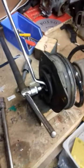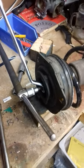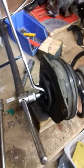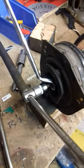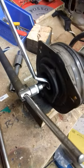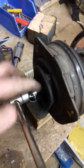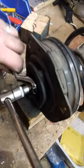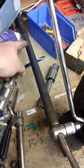I'm taking the tops off the shock absorbers. It's been up right overnight and the depression in here has been filled with Plus Gas, or whatever you happen to use to try and release rusted-up nuts. I've got a socket allen key in there that's actually fastened through a jack handle.